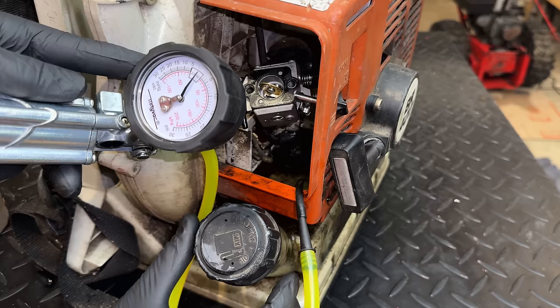And a few days later, while en route, I decided to start both of them just to make sure. And the BR380, no issues. The BR400, though, had issues. It wouldn't idle. So I brought the idle speed up, tried adjusting that low speed needle, and after a bunch of fiddling, I finally got it to idle, but it wasn't happy about it.